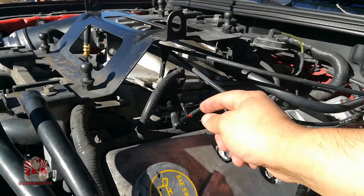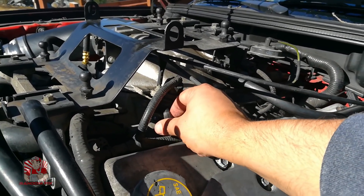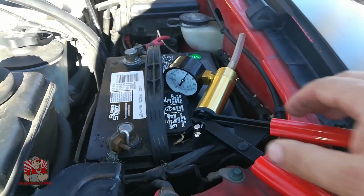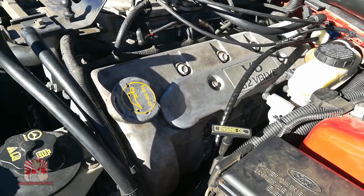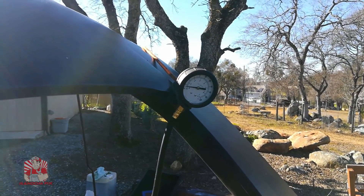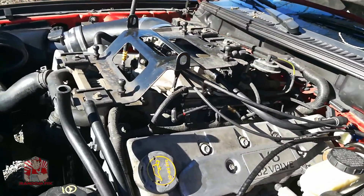This is something that you can easily check and I'm going to show you guys how to do this — just by removing this right here, this is going to be the vacuum coming off the motor. You can use a vacuum gauge like this and I'm going to show you guys how to do that. And the other thing you can do is use a scanner and I'll show you guys how to do that as well. I have a fuel pressure gauge hooked up on my vehicle already right there, so it makes it a little easier for me to see what's going on with the vehicle.